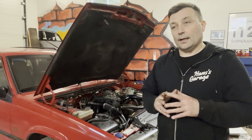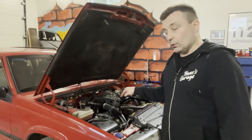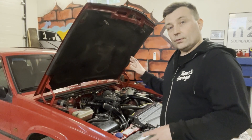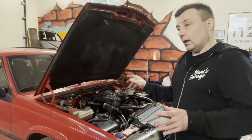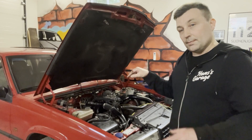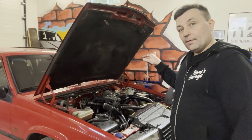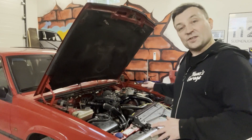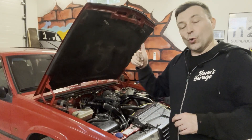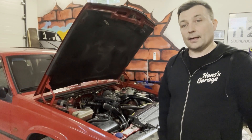I have to get back to the drawing board. I'll wait for comments from my Finnish channel too if anyone can advise how to fix this. But I have a Plan B - the previous owner installed an extra temp sensor near the radiator. If I can't get the original system to work, I'll connect that and connect the relay to half speed, then run a new wire into the cabin and put a switch to ground the full speed. That way I'd have automatic half speed and for high load I can push the fan to full speed from the switch.